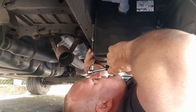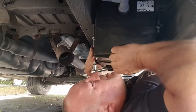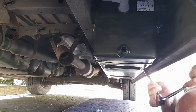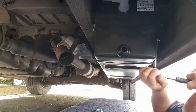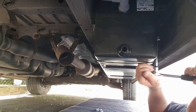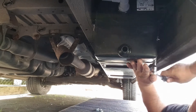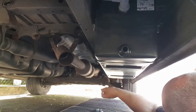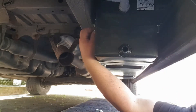Once you're happy that your brackets are all lined up and square to the tank, there's nothing to stop you just tightening them right up. Once you know it's in the right place, it's a one-off job — get it tightened up, you don't need to keep it loose. Just keep an eye on your brackets and make sure they're square to the tank. Once I'm happy everything's nice and tight, I fit the two nylocs just for peace of mind so the nuts won't back off. I may have to come back and tighten them as they settle in, but that'll come to light on my checks.